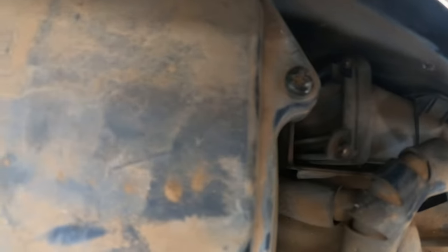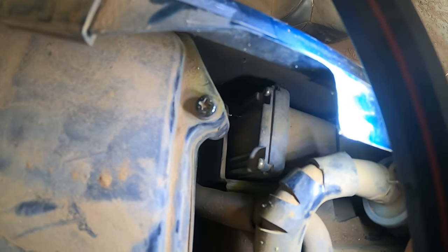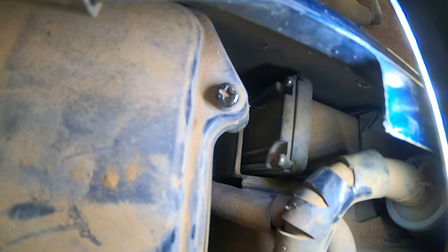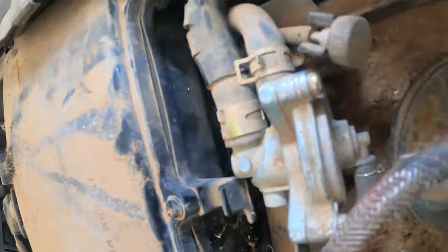Nearly every one of these screws has it. I paid around $25 to $30 for a JIS 1, 2, and 3 — equivalent to your Phillips 1, 2, and 3. I've personally stopped using Phillips — I use JIS for pretty much everything. I experience way less cam out with these JIS screwdrivers. Just due to their design, they're made to grip better and you can apply more torque. For loosening stuff, I can use these whereas normally I'd have to use an impact.